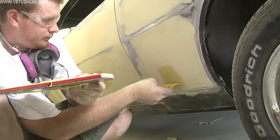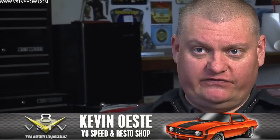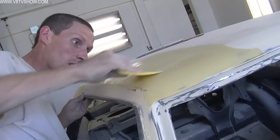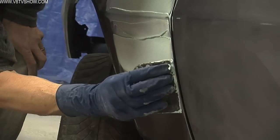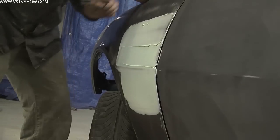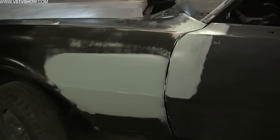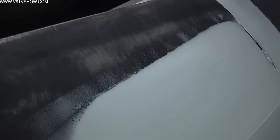Application is pretty straightforward but it does take some practice, especially if you're trying to cover a fairly large area. In a lot of cases the cars we build, we end up skimming these things from end to end and sanding 99% of that filler off. So you want to make sure that you spread it on with a uniform, consistent stroke and don't overwork it. Get it on the car and spread it, then you can come back and knock down the high spots a little bit. It's not something you have to keep working, because you'll end up overworking the filler and it's going to harden before you're done pushing it around — it can start peeling off, or you'll end up spreading it too thin and having areas where you've got little craters.